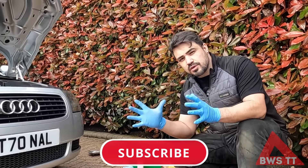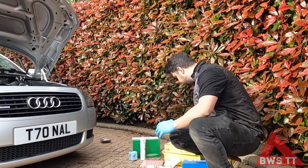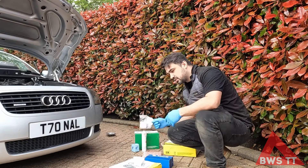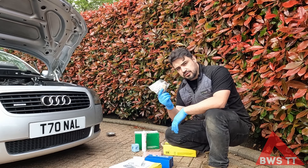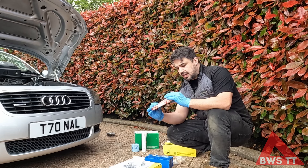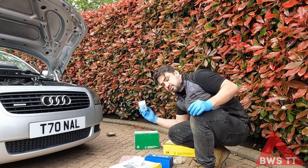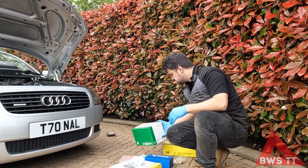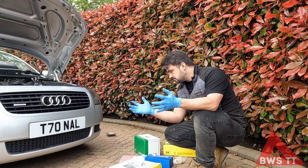I know what you're thinking — Bryn, you don't do work for other people anymore. Well, I do little bits and bobs, and Nick had contacted me about getting his clutch done around the time that I stopped, so I'm going to do the clutch for him. We've got a full LUK setup, and because we noticed an oil leak around the sump area that wasn't resolved by doing the sump, we've got the main seal for the input shaft on the gearbox and the crank main seal. We've also got Haldex oil and filter, and the INA cam belt and water pump kit with the tensioners. The Gates kit is no good anymore unfortunately, so let's just get it all fitted.